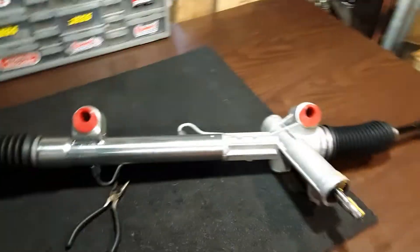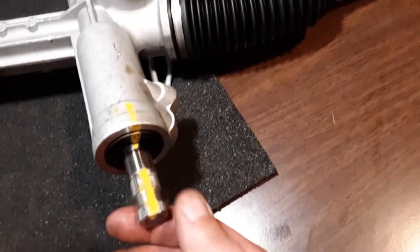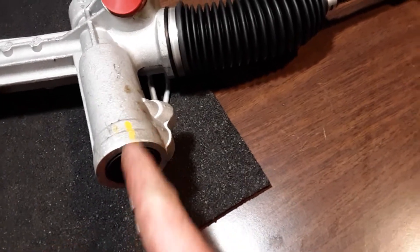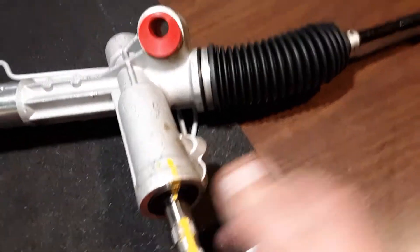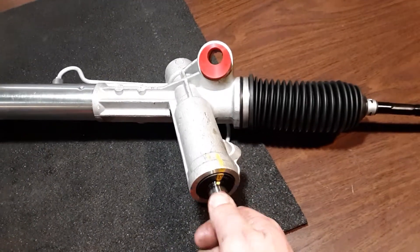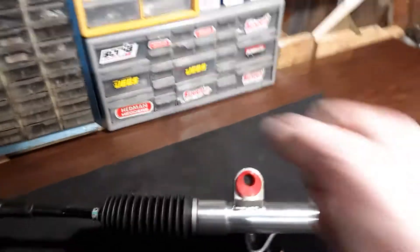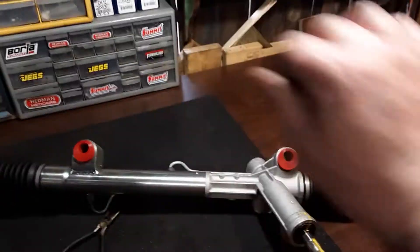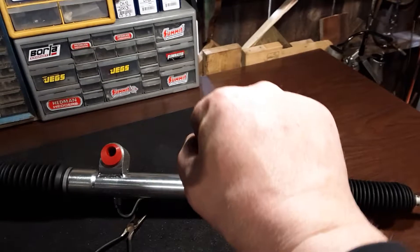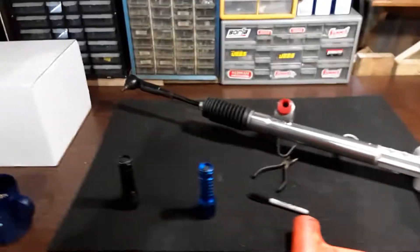We're going to put this one in the race car and see how it goes. When they come, they come pre-lined — you can see how it's marked with a paint marker to show it's already preset. When you put it in the car, just put it in just like this, don't move it, because the geometry and how much you can turn left and right is centered. You don't want to put it in off-center and find out you can't turn one way.